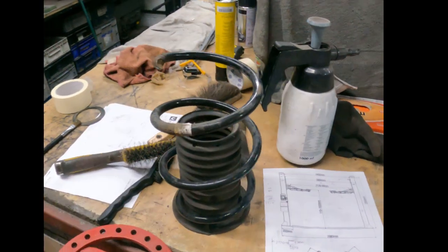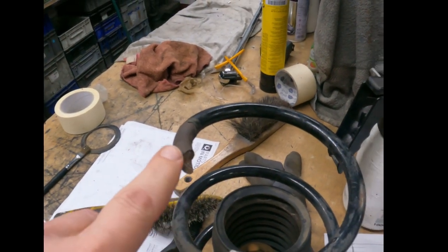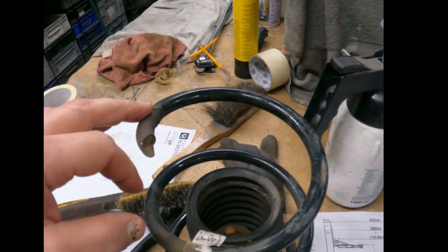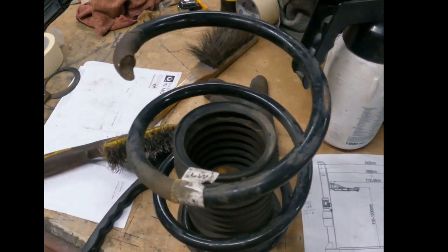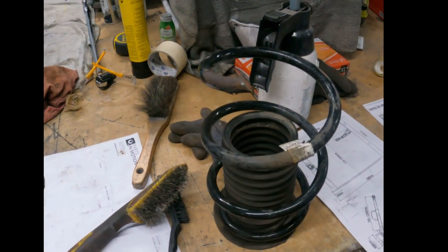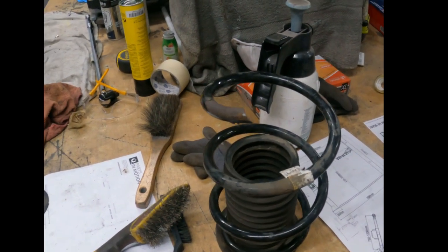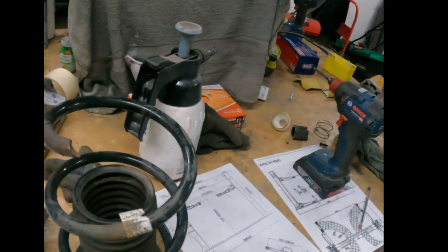I mean, it's a 2016 plate. Yeah, I'll show you the spring. These are quite renowned for snapping. So there's a little bit of surface rust. It hasn't gone through. It's taken the paint off it a bit, but there's a bit of a dagger on the end. A boot had split as well. But yeah, it wasn't really drivable. I suppose we should think ourselves lucky, because that spiky bit there was rubbing quite close to the tyre. So with that snapping, that could have quite easily gone through the tyre and exploded, or taken a brake line out or something like that.